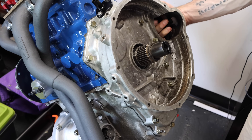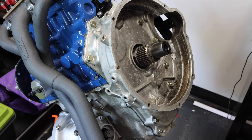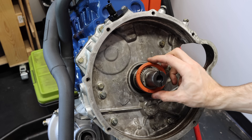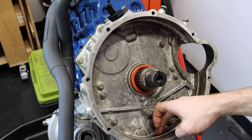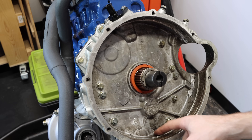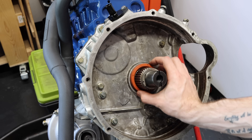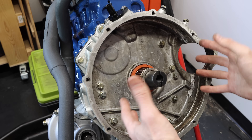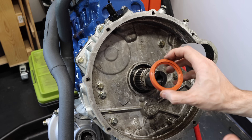You can see here I've actually got a stopper here that holds the flywheel in place when you tighten it down. I'm going to remove this because I don't want it on there while I'm actually installing the flywheel — only when I'm torquing it down. The next thing that we're going to be installing is a rear main seal. This seal goes around your primary gear here all the way down into that spot. This is one of the most common places for oil to leak from. There's actually a small hole right down here at the bottom of your transfer case — normally a cotter pin's in there — which gives you a visual indicator if you have oil leaking out through your rear main seal. This seal holds back all the oil from your clutch assembly, the flywheel, the clutch — all of it — because this area needs to stay dry. If you get oil on your clutch, it's going to slip.